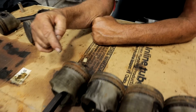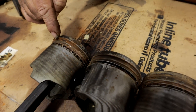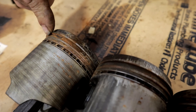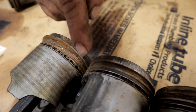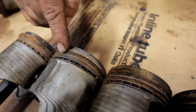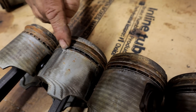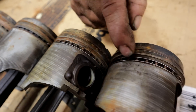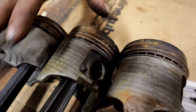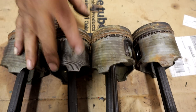These four on the other hand — this one has a partially stuck top ring, but the second ring and the oil ring are both stuck. Same thing here: partially free top ring, but the second ring and the oil ring are both stuck. Same with the remaining two. So four pistons each have a stuck oil ring and a stuck second ring.